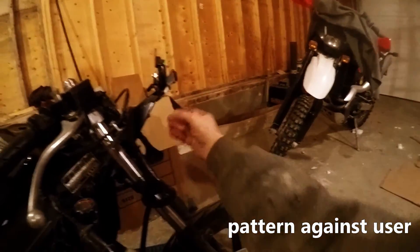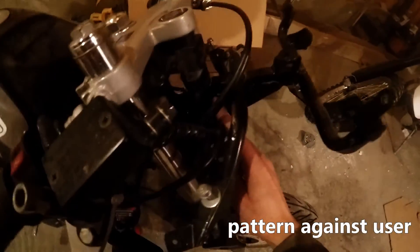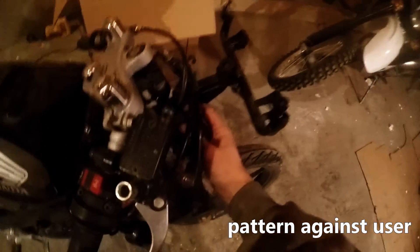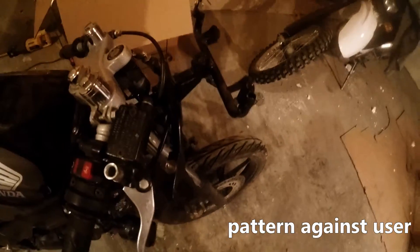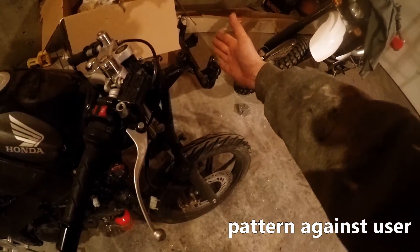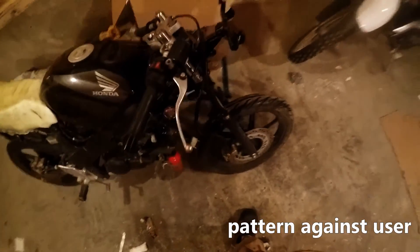I'm just going to cut these off. Funny story — when I put my instrument cluster on, I notice that this hits. So basically I'm going to chop this here, move it out an inch straight this way. That will hold my front and my instrument cluster one inch further up, so I get a little more clearance. You can even see the brake lines are getting a little jammed in here. I'm going to save that till last — basically line up this, screw in my holes, chop this, push it to the front of my fiberglass form, tack it in place, weld it, and then just drill these holes wherever it sits from there. So that's the game plan.